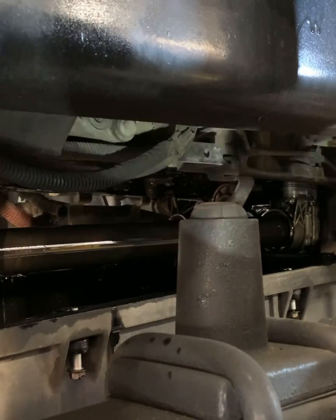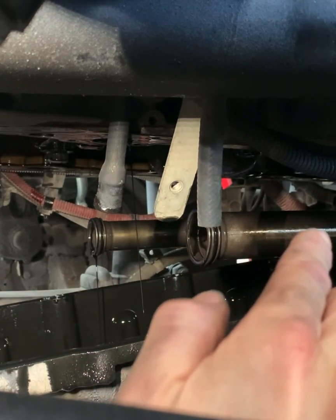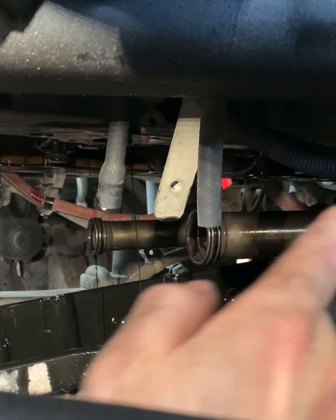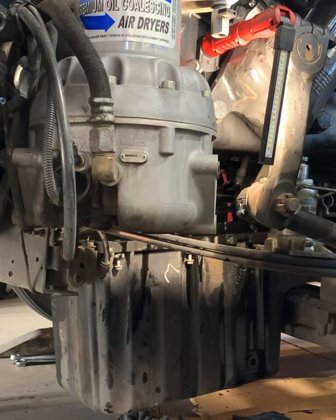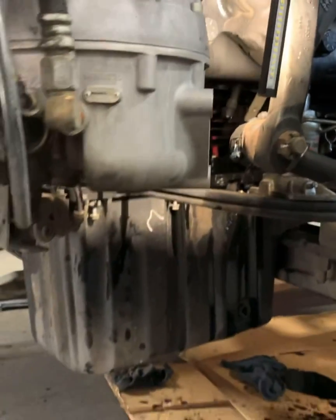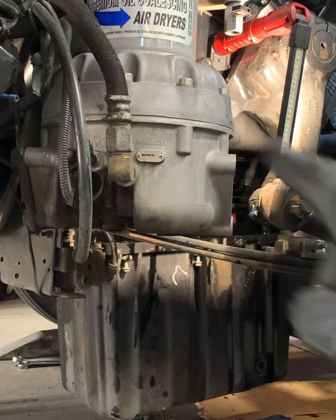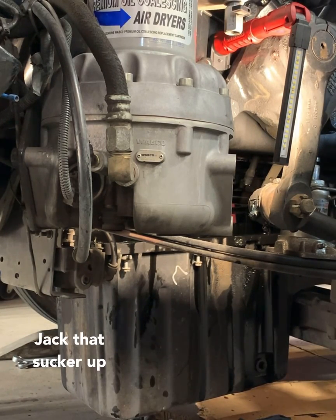Continue to fight — I got it, I ripped it. Put it down. Now I can either drop the pan as it is right now or take off those tubes and put them in the pan as well. Either way they're gonna be a fight to take off because those O-rings are tough. Same thing as before — I got my jacks in there so I can raise it off the spring and clear that front section. Get a jack on both sides, raise it up, and then we can go ahead and drop it. The oil suction tubes did not want to come out, so they're gonna fight me later. We're gonna go ahead and just drop the pan and then muscle those suckers out of there — cuss them up a little bit, smack them around, give them some love. You know, the usual.